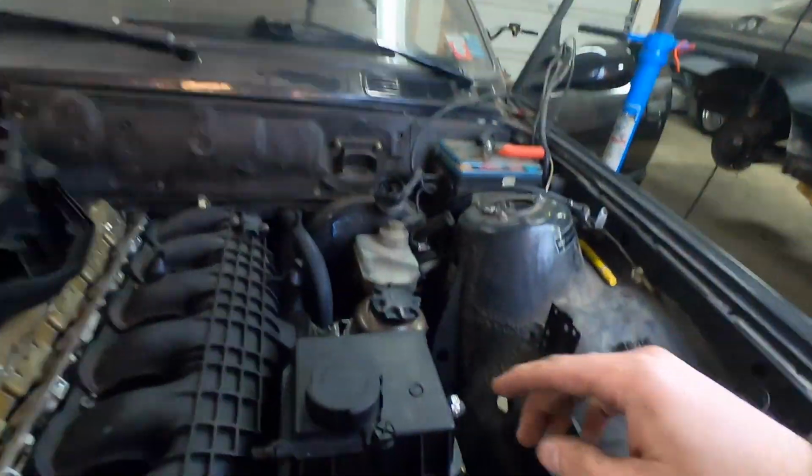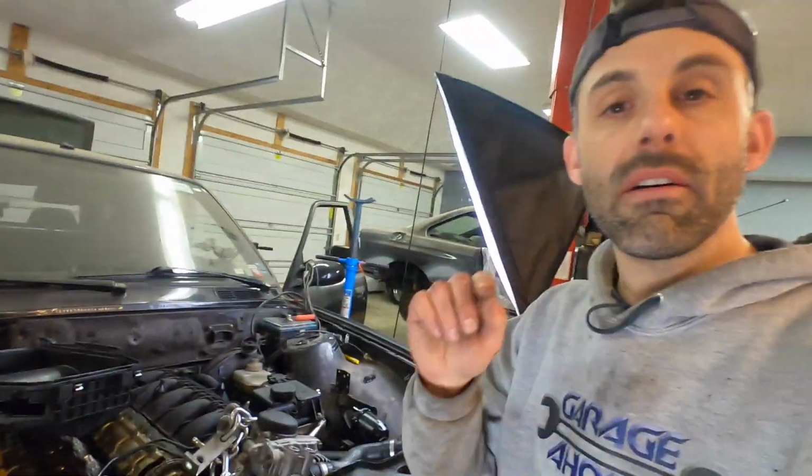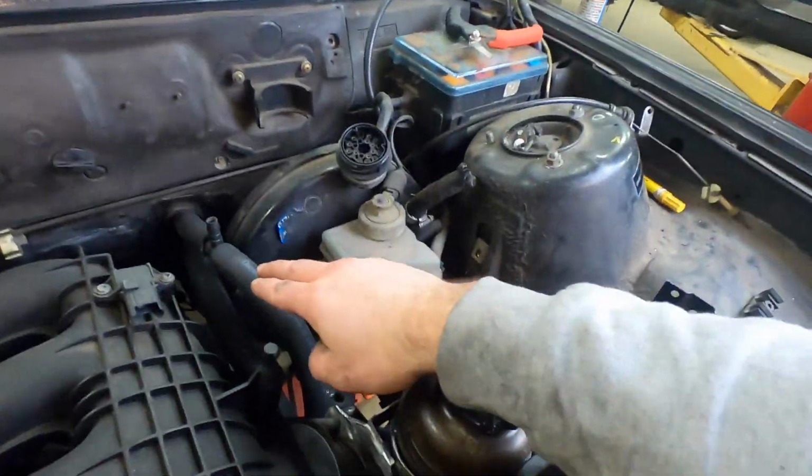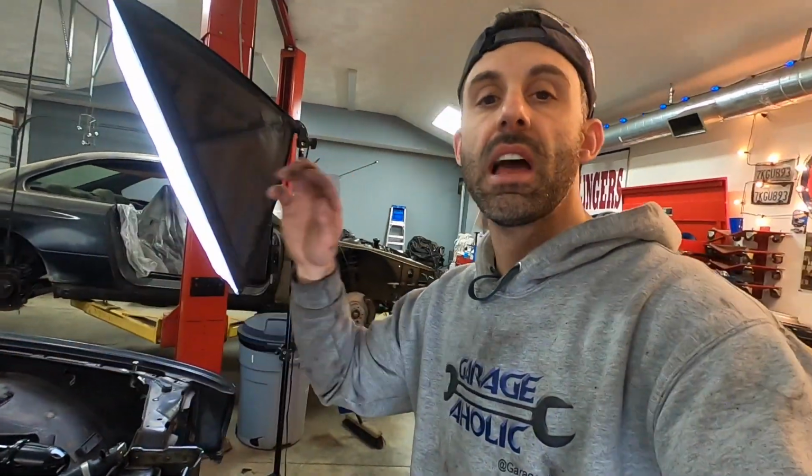Understand, right? There's a bleeder right here on the coolant reservoir. However, if there's a high point in your custom coolant system, you need to add a bleeder there as necessary. Here, I think it's necessary to add one in the upper heater hose. So while they make $40 or $50 three-quarter inch bleeder hose T assemblies, I'm actually going to try to make my own. I might do that in this episode, and I might do it in another episode. We'll see. But as it is right now, I'm going to leave this alone for mocking up and prototyping purposes only.